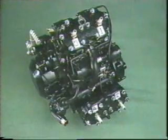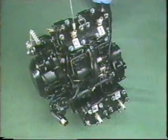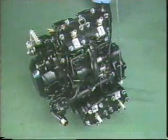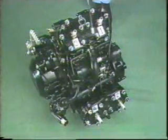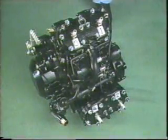and reassembly. The machine is powered by a V-type 4-cylinder engine. Each cylinder is individually numbered. Viewed from the rear of the machine, the top left cylinder is number 1 and the bottom left is number 2. The top right is number 3 and the bottom right is number 4. You must remember this numbering by heart.